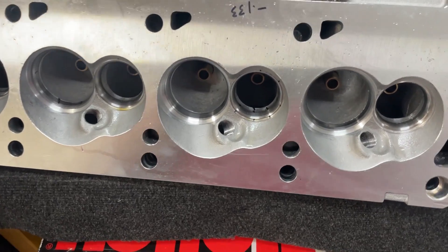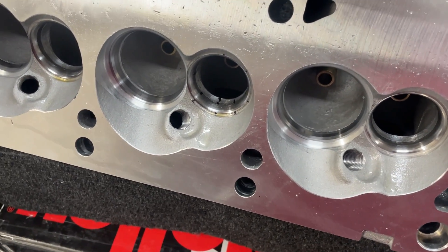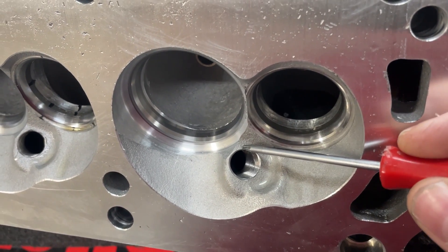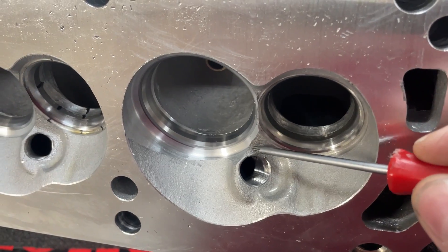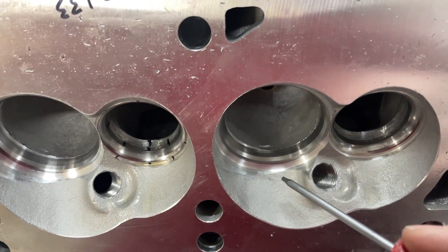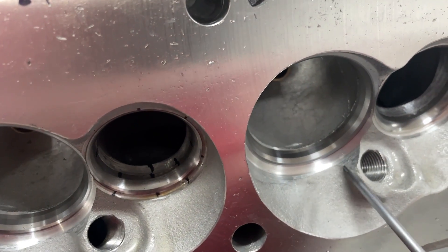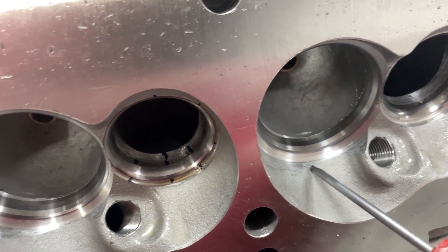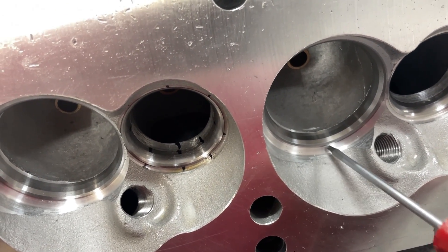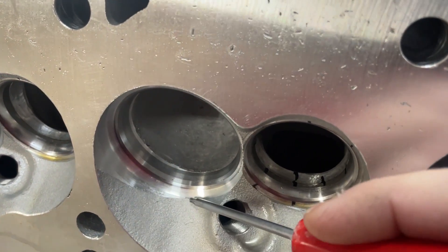Here's what it looks like after the valve job's done. The chambers got really close to that spark plug, like I said — not too much to worry about since LS's are about the same. However, if you just left it like this it would be terrible for flow, because you can see that ledge — it's huge. The valve would probably have to be at around 300 thousandths lift before you got out of that ridge, and even then it still keeps hitting that ledge hard.